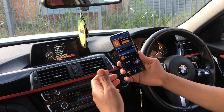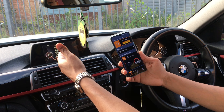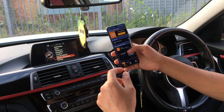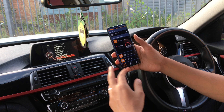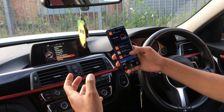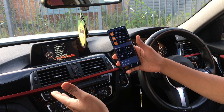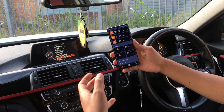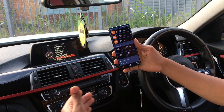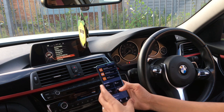I've really experimented with a lot of things. I've changed the iDrive itself to show M Performance every time it reboots. At the moment the health is showing very bad, just like almost every single person. You can customize through coding the way you'd like. So far I've coded only two things: the M Performance logo, and the wing mirrors to automatically fold out at one mile speed. Previously it used to be up to 20 miles — when you're driving at 20 miles that's when it used to auto fold out. I'd like them to open as soon as I'm moving from stationary.